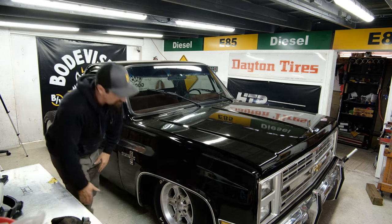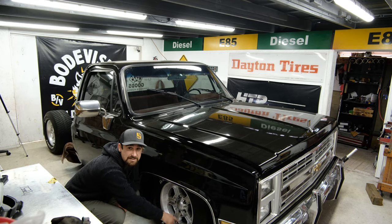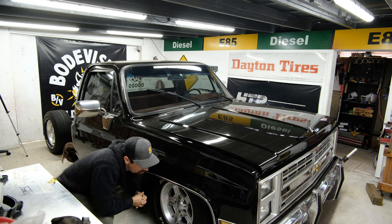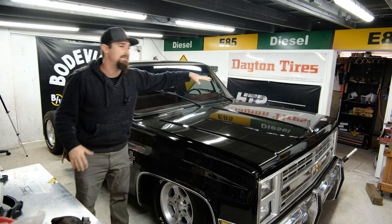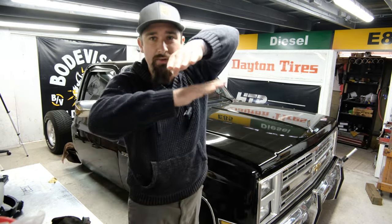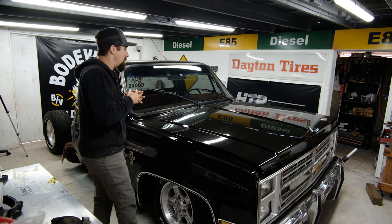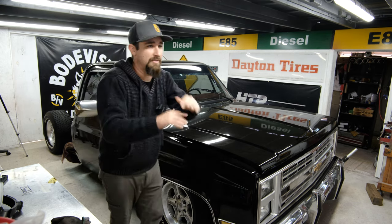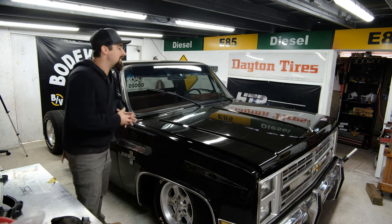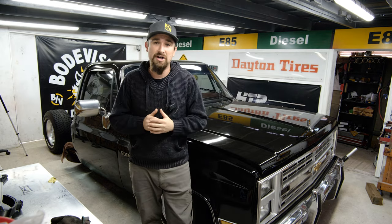As you can see we definitely made some progress. Keep in mind this is a 15, there's going to be a 20 going on here. I cannot wait to show you the wheels we got ordered for this thing because they are on the way. Either way, I could not lower that side enough because as the lower control arm goes up, the steering column shaft is right there and the lower control arm hits it. So that is going to have to be reworked a little bit. But that is the name of the game — I enjoy seeing a problem and addressing it, chasing out the problems until they go away and then we are done. So much to come in the following videos — make sure you click the link in the description down below to win that slam box. I'll see you on the next one.